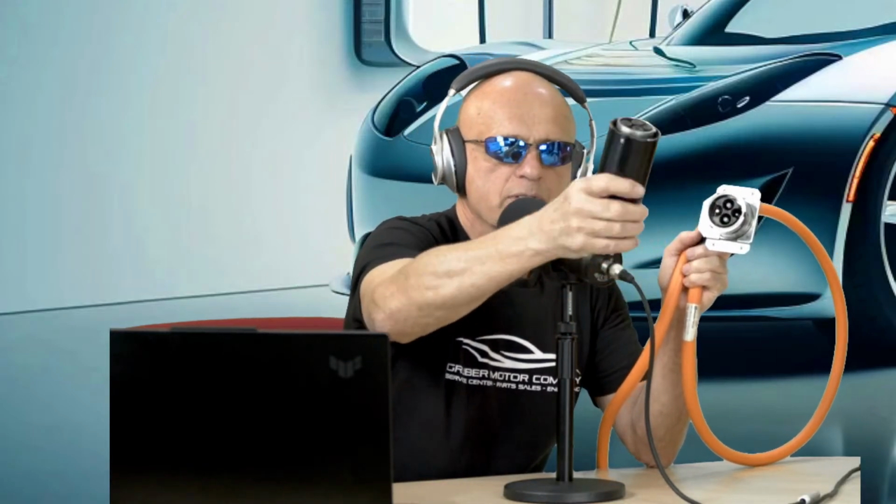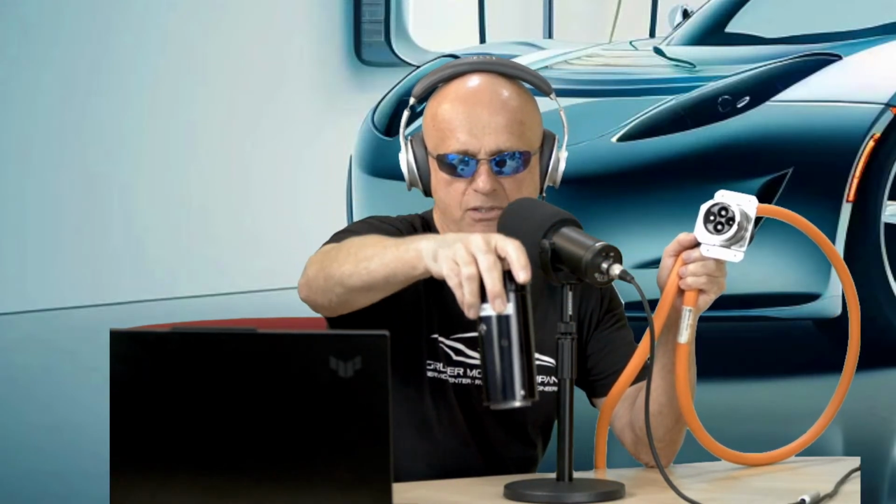Yeah. So this is a CAN Senior, which essentially allows you now to use a NACS connector on a Roadster. Well, we thought about this for a bit. Henry Sharp makes these, and he's got the CAN Senior and the CAN Junior. The Junior is the J1772 to Roadster. Senior is the NACS to the Roadster socket. It occurred to us, why not change this socket to a NACS socket?